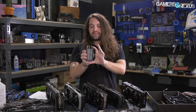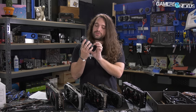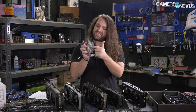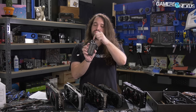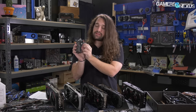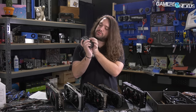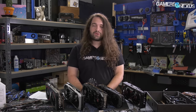This handles the heat. So it's a fairly dense thermal solution. You have a set of fins, and then you have what we think are ceramic wafers in between. And this looks like it's where you're going to get the power for the heat generation. There's a thermistor. That's it right there for detecting the temperature. And then there's what we think is a fuse. It is labeled 250 volt. And there is supposed to be a fuse that blows if you plug it into a European wall outlet, something where it's more than 120 volts, the US outlet.